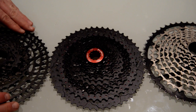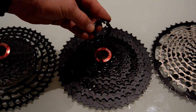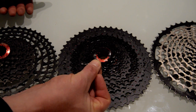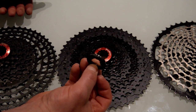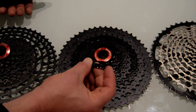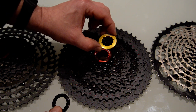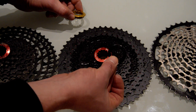An interesting note: the locking ring for the Garbaruk is purchased additionally to the cassette itself, whereas both the VG Sport and Sunrace include the locking ring standard. The Garbaruk locking ring only weighs about 5 grams, but we had considerable issues with it actually staying locked - it's built so light that it's a bit of an issue. So we ordered some Chinese-made ones which have been absolutely terrific and are only one gram heavier, at around three dollars versus nearly thirty dollars Australian for the original.